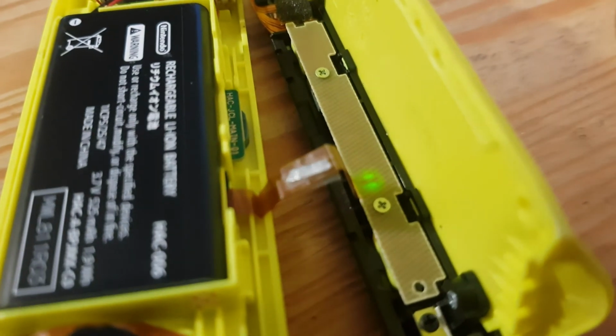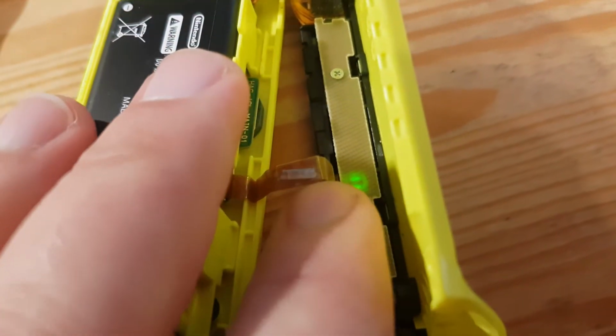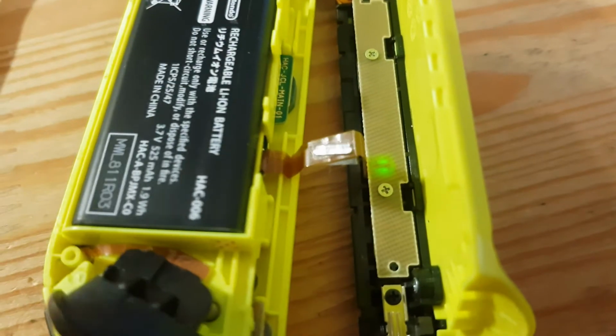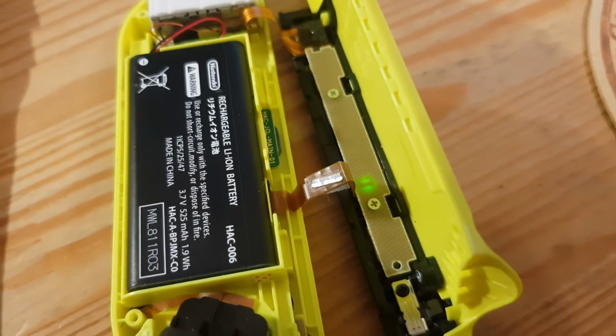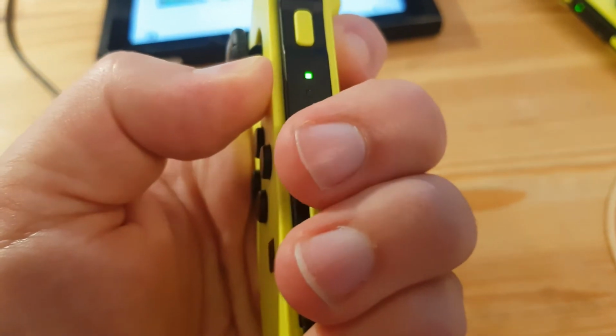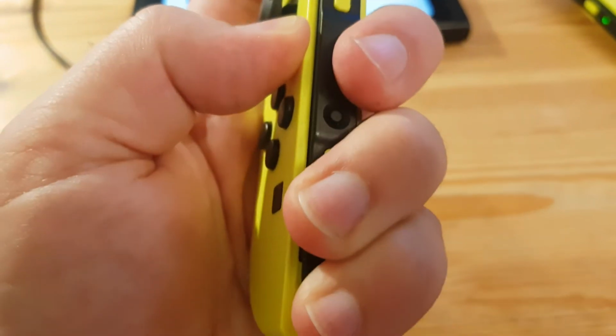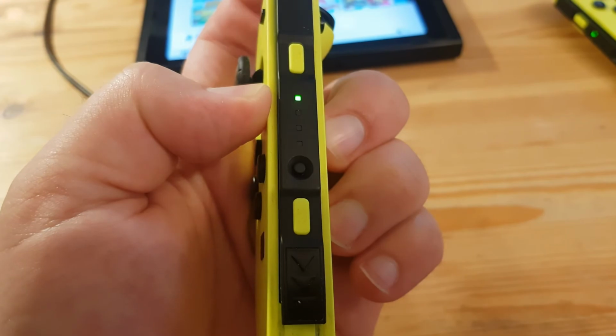After a little bit of a search, I noticed that there was a faulty connection where the ribbon cable was bent. I taped the broken metal piece from one of the joysticks I broke onto the original bend of the ribbon cable to fix it and just bent it in another position. I could put everything back together and all the LEDs work flawlessly. I could have, of course, ordered a new ribbon cable, but why would I? Everything works perfectly fine.